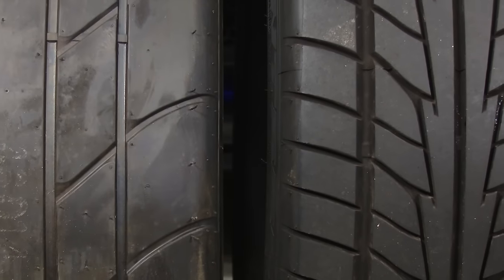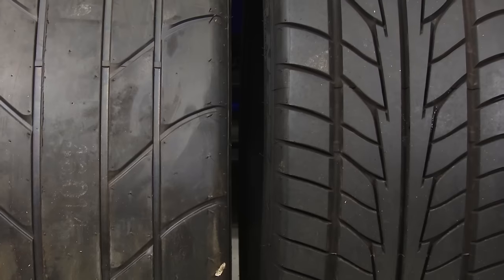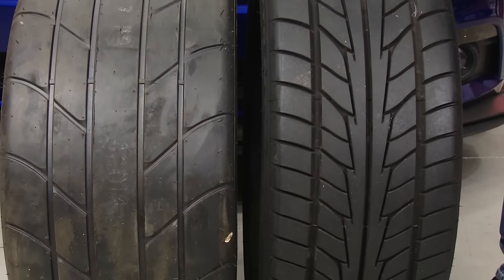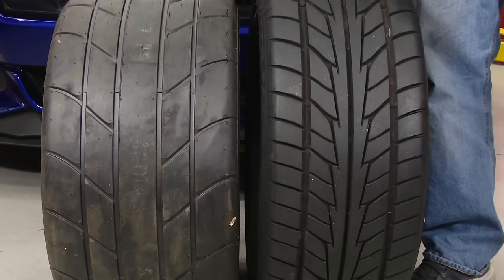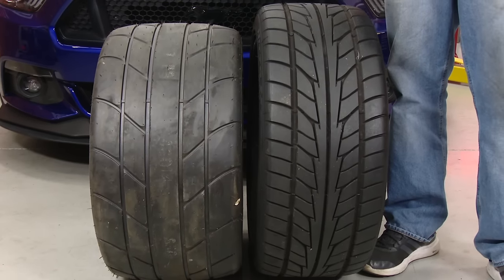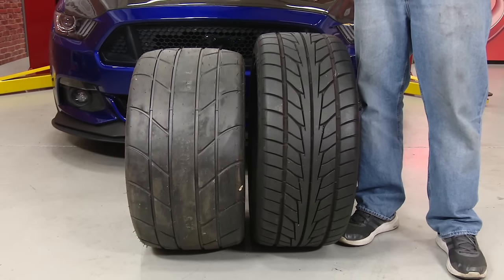Before we get into what you can expect at the actual track, we're going to talk a little bit about tires. This is geared towards your first time drag racer, so we're going to leave slicks out of the equation — if you've never raced before, you should not have a slick on your car anyway. More than likely you're going to have one of two tires: your normal street tire, or you might have a drag radial. If you're running a normal street tire, you want to run it at normal pressure — no burnout, don't go through the water, nothing like that. You want to go around the water box, maybe give them a quick spin to clean them off, and you're ready to go.